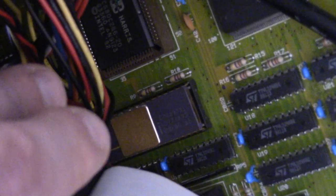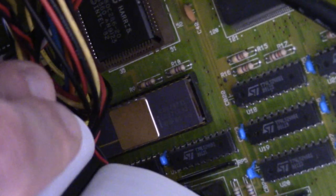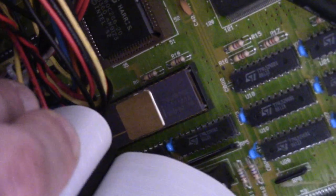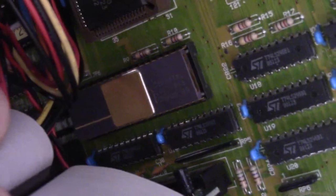Now, also of note is the math coprocessor, and we'll talk about that a little bit more in a minute. Right now I have the 287 XL in there, which is a cut down 387 processor. But prior I had a 20 megahertz true 287. So we'll look at some numbers later and see which one of these is faster. This one should be the faster one because it is more advanced. Like I said, it's just a 387 math coprocessor cut down to work in a 286 motherboard.